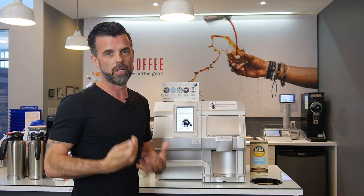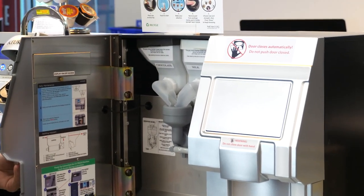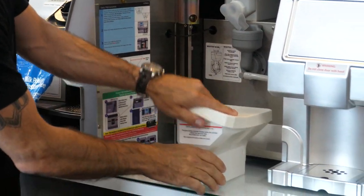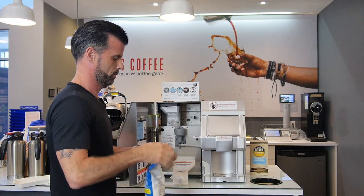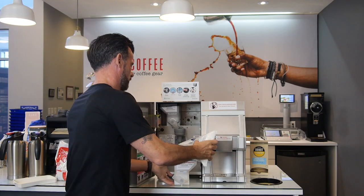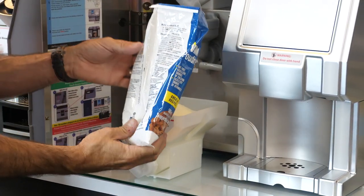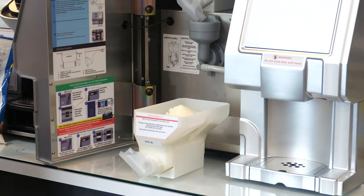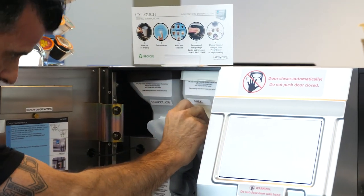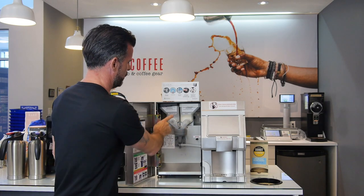The other thing you're going to need to do is refill the milk and hot chocolate powders — very, very simple to do. All you have to do is open this side door here and you have access to your hoppers. The hoppers have little spouts; turn them up and pull them out. We're going to fill this one up here. One is labeled milk, one is labeled chocolate. Fill it up outside of the machine like so, put the lid back on, and then place it back in. There are guides to help you — the first time is going to be a little tricky, but it sits in a little notch. Turn it down, and you'll do the same with the chocolate when it runs out.